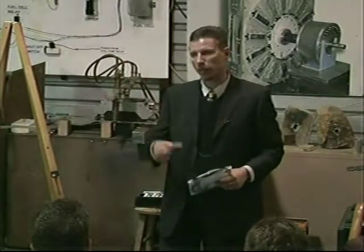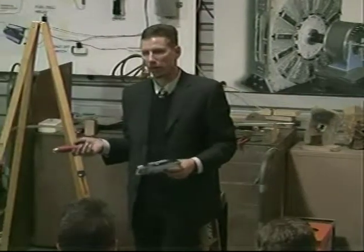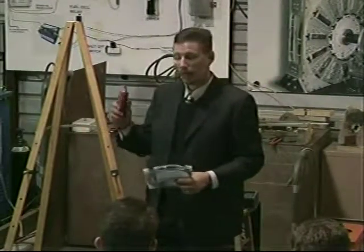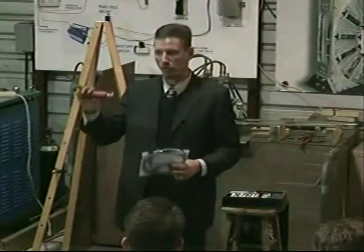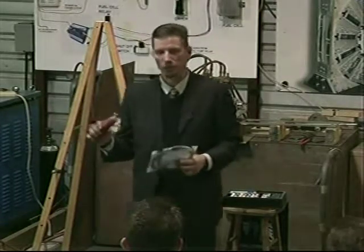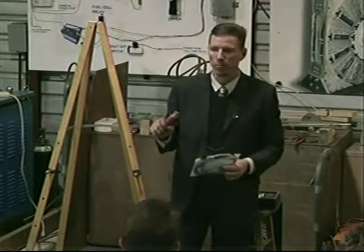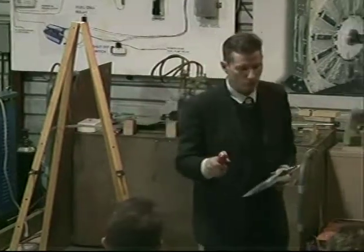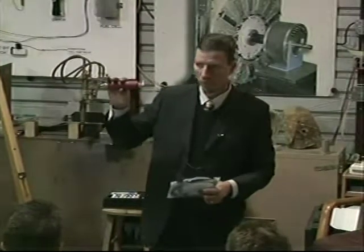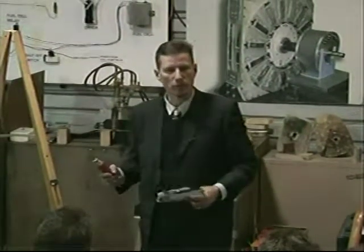At least on recirculation systems, we've got constantly flowing fuel. Deadhead systems, like a lot of the later model stuff, don't have a return line. And your dwell time, it sits there and absorbs more heat before it gets to the fuel rail. So they seem to do a little better as far as how much temperature we can get into the fuel. But vaporizing the fuel, this will elevate the thermal energy of the fuel so that we can phase change more of it to a vapor.